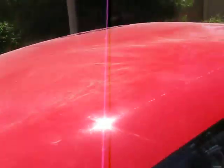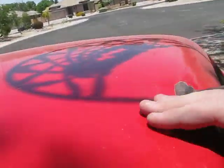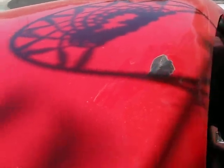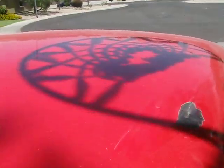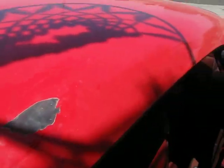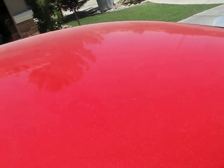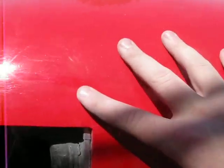Not a big deal. And then up on here — it's on the other side, actually. Right where this paint's off, it's got a little dip in it. So I'm going to actually try and pull it out instead of filling all that, because I don't want Bondo in the roof if I don't have to. And if I have to, I'll use lead, because this is all structural — and Bondo cracks where it's structural, so I figured I'd use lead instead.